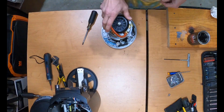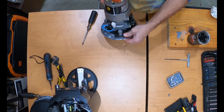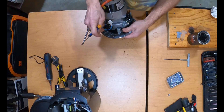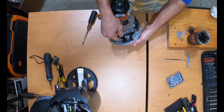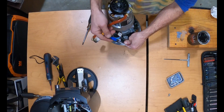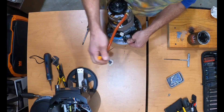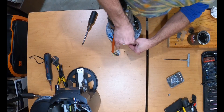The next challenge is this piece right here — it locks all the gears when the lock's not on or the motor's out. There are two little metal barrels or studs that act as a hinge. You have to press down, take a small flat tip, get behind the edge, and pry it out. Do that on both sides.